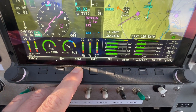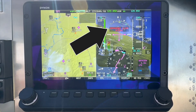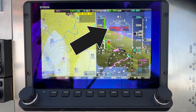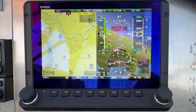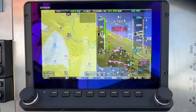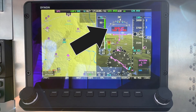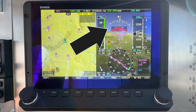Autopilot mode. You heard it say autopilot mode, and now it's showing emergency glide active — that's what I'm seeing on my screen. From that, it has determined that 17 Sierra is my nearest airport. You'll notice that the airplane is taking its time to pitch to our best glide speed, which is 80 knots in this particular airplane. We're pretty close to the airport — we're actually about 3,200 feet above it.